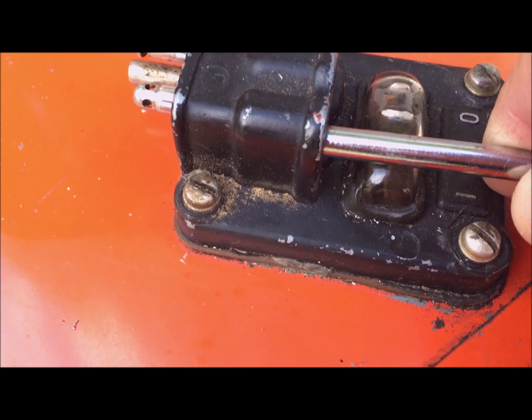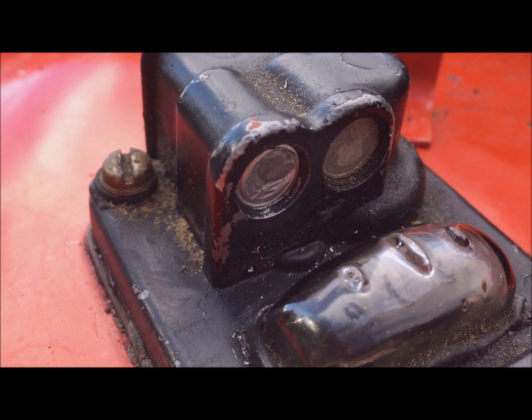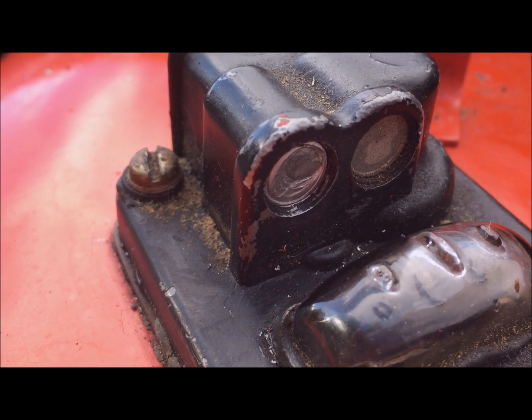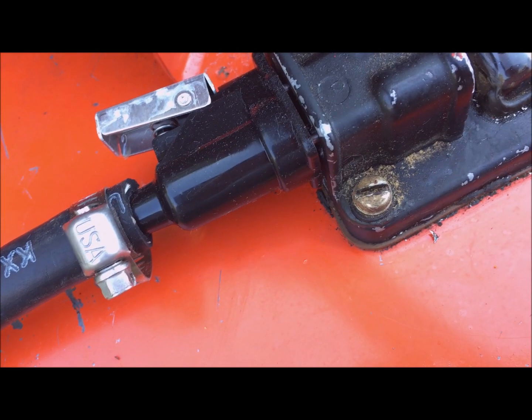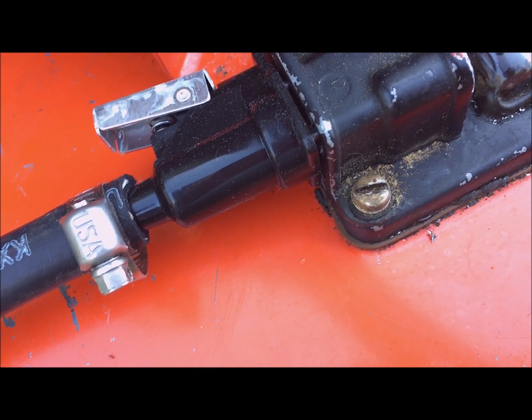Strike it with a hammer. You can see the diameter of my flat punch was not as big around as the factory punch, so it took tapping in a few places to ensure that the plug was fully seated. Now we're going to check for leaks — no further fuel leaks.